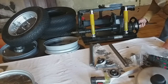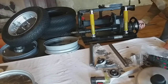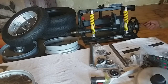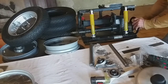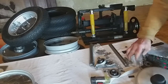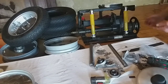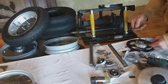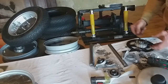Now if you measure it on this one, it's a fraction under. So what I need to do - and I've seen this on quite a few scooters - is I'll put a small little washer inside that before I screw the plate on the end that holds the wheel on. Now going back to these plates on the end, because before now on one occasion I did have one of these come undone - now slightly loose.